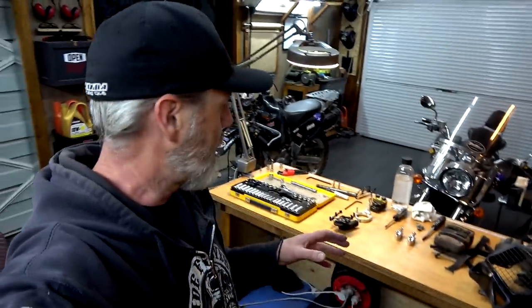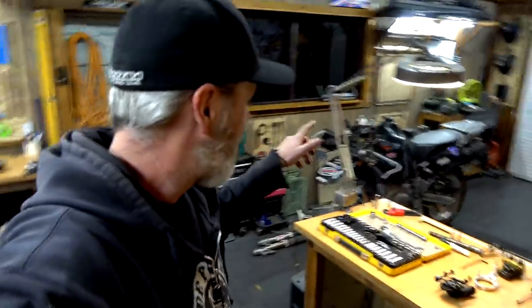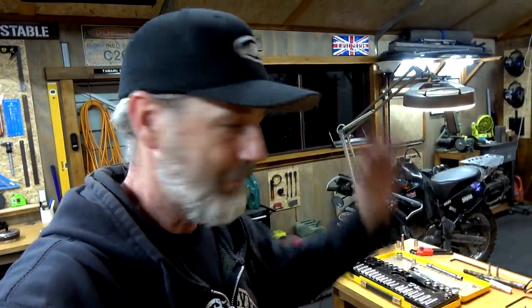This is a little lesson for those DIY backyard budget bike building people — aka me. This is why you take stuff to a mechanic and get it done properly, unless you're like me and you learn by your mistakes. I'm quite happy with that. The problem I had with Max's headstem — the nut on the Ramble — I totally lost the whole bloody nut. The reason for that is because when I put that triple clamp on, I tightened up that nut on the top after already having the forks and all that done up.